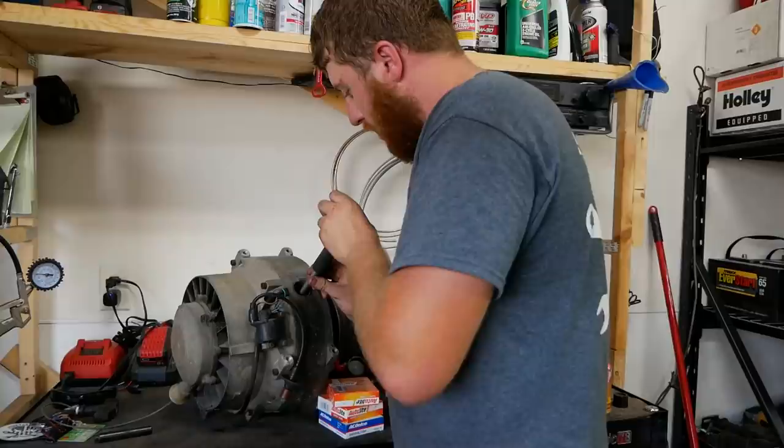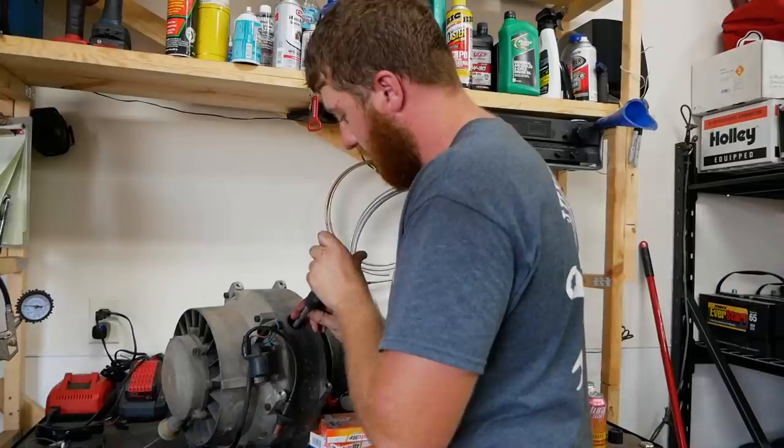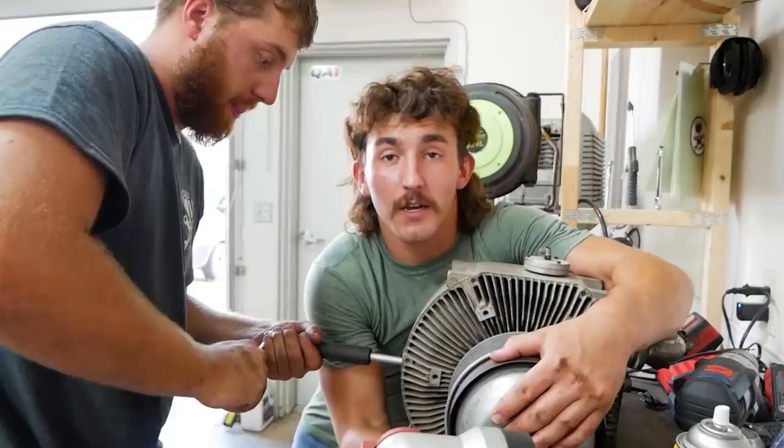The hardest part about a helicoil, which is the most important part, is usually you have damaged threads when you do this, so you have to make sure it goes in straight. Or you're gonna have an offset spark plug that will never seal. Some people like to hug trees. I like hugging engines. Still clear? Yeah, still clear.